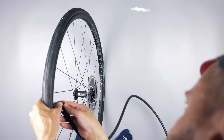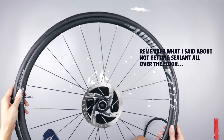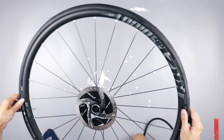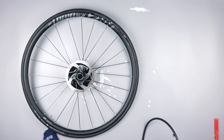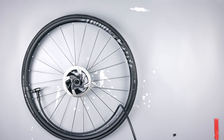Unfortunately, the next thing I did was fill the tire with sealant. My thinking was that this would help seat the tire as it sealed at the same time. However, as you can see, that's usually not the case. Whatever you do, even if you don't manage to seat the tire, at least make sure it holds a bit of pressure — that will prevent the sealant from getting out all over the floor like it did for me. I was too stubborn and kept going, making a huge mess. Do this outside — don't do it inside, for the love of god.